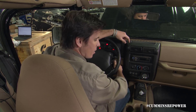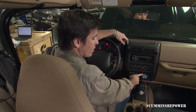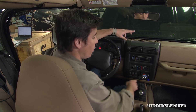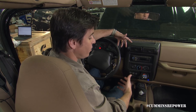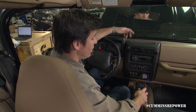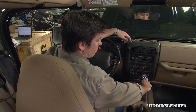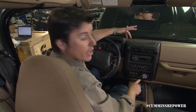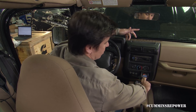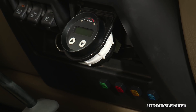So let's see what happens when we key back on. All our lights come on and we should expect to probably see an amber light come back on — indicating you still have this fault in memory. The engine's not running yet so it doesn't know it's been fixed, but it does know the circuit is complete, which is why we don't have the stop engine light anymore. I can go ahead and start it now. If I go back to my home screen, I can see the engine's running. After a couple more key cycles, that amber light will disappear since the fault has been fixed.